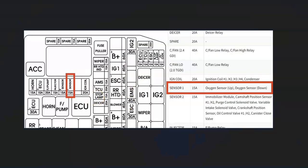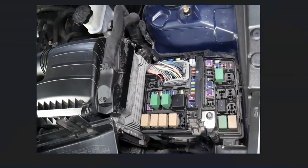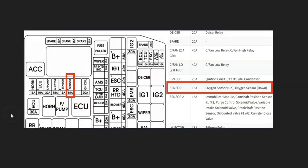These sensors are also on a fuse. The fuse box is located inside the engine compartment — when you pop the hood, there'll be a fuse box with a fuse inside for these sensors. In a Hyundai, the fuse for the oxygen sensors is usually labeled 'sensor one,' though there can be some differences. For example, right here: oxygen sensor upstream and oxygen sensor downstream would be sensor one. If that fuse was blown, that could cause problems, so always check for blown fuses.